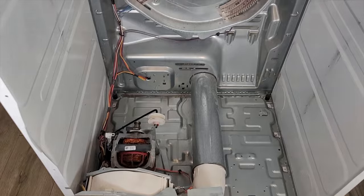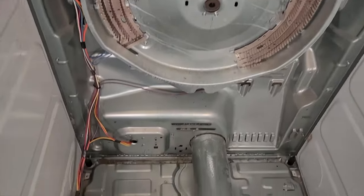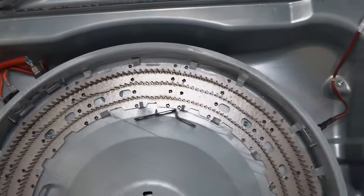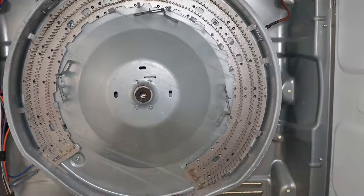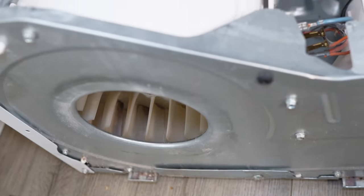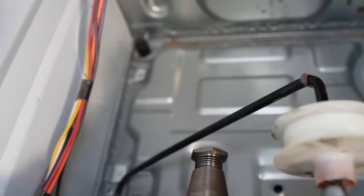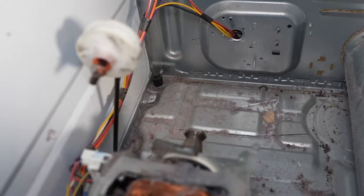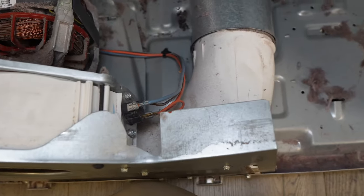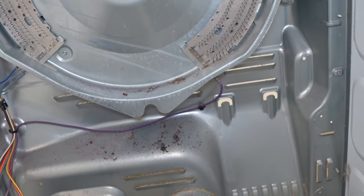These are all the major steps I would take in dealing with your GE dryer either not heating or drying your clothes. If everything looks to be okay, make sure all the wire connections are intact and not possibly unhooked. Another thing to check for would be a floating neutral situation. Floating neutral is where the dryer powers on and runs, but your voltage drops when it's actually in use. You would test this with a multimeter and voltage at the terminal block, and you would need to make sure that the unit is running and get at least 208 volts. If the voltage suddenly drops when it powers on, then there's an electrical issue somewhere between the outlet and the breaker itself, and that is far beyond the terms of this video.